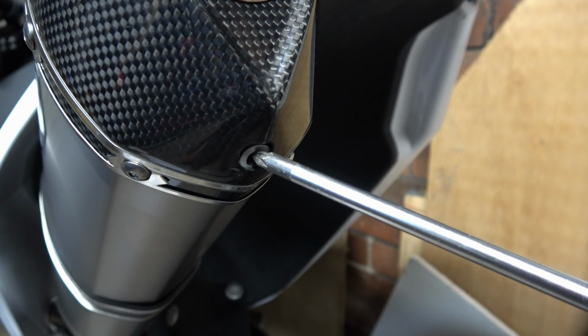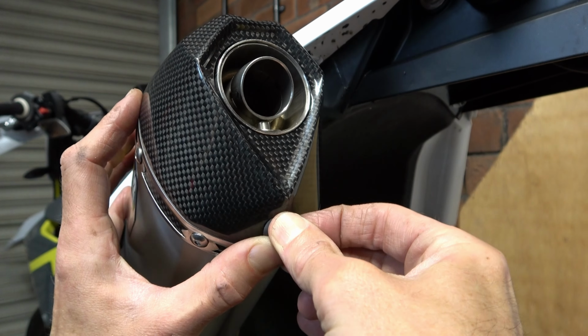And once tightened up, I notice the lost washer hiding in the bottom of the exhaust, so I get a magnetic tip screwdriver and drag it out. I place the spare bolt and the spare washer back in the spare baffle for safekeeping, and then finally put the rubber cap back on the exhaust.